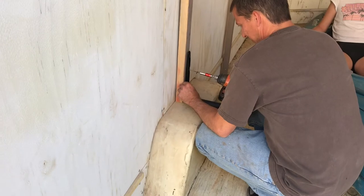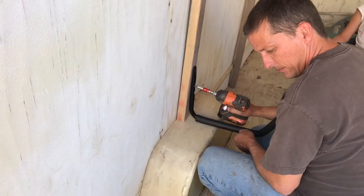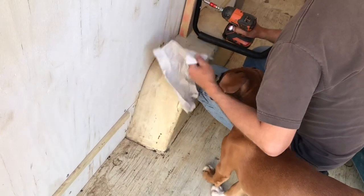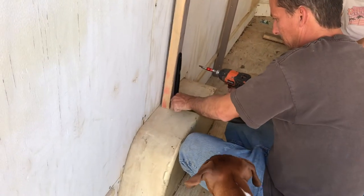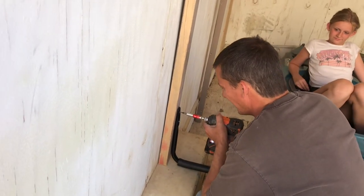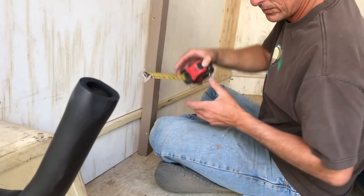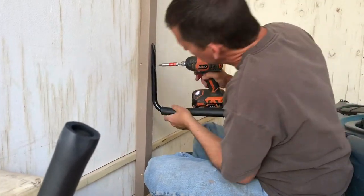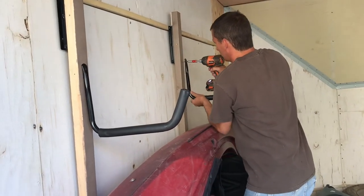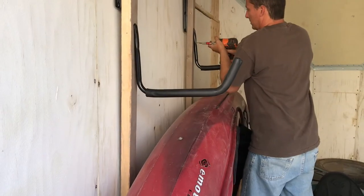On one bracket I had to cut it so it fit over the wheel well, then anchored the kayak bracket so it was basically laying on the wheel well — because I needed as much room as possible to the top of the trailer to fit both kayaks. I anchored the one over the wheel well first since I knew that's the height it needed to be at. Then using a tape measure I measured how high off the floor that one was and measured the second bracket to make it the same height. I set a kayak in the bottom bracket to see how much room I needed before mounting the other brackets.